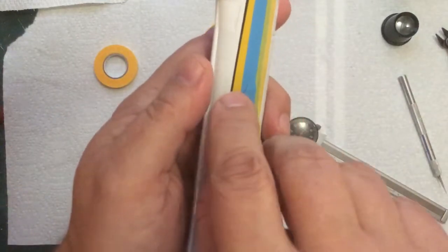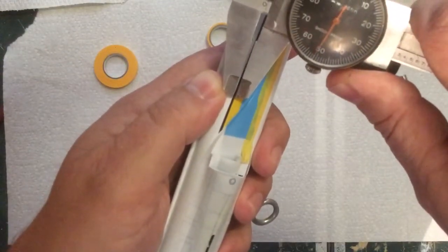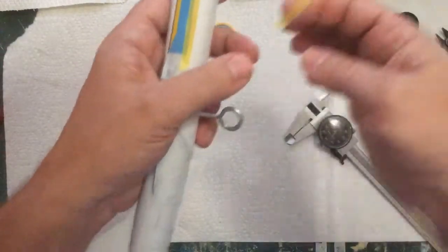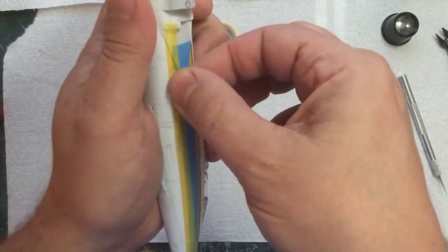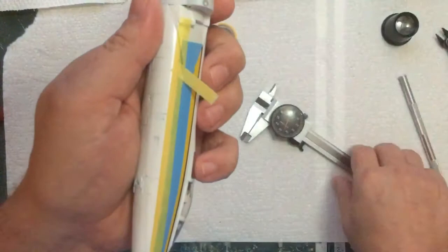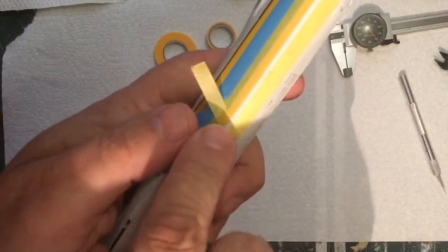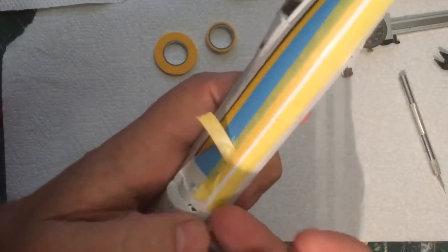There's a panel line right here, so I'm going to measure the width of that stripe, being very careful not to touch the paint with the point of the calipers because I don't want to scratch it. I'm just eyeballing the width and that'll give me an idea for over here. What I'll do is take a piece of scrap tape and eyeball it — lay it on about here and see if that's the right distance back, which will give me an edge to lay the main tape on. I'll do that off camera and show you what it looks like.